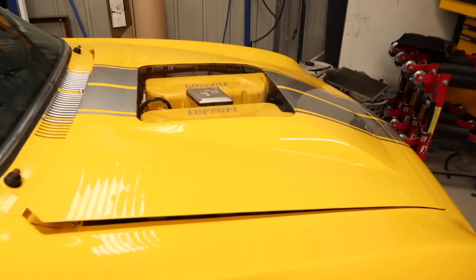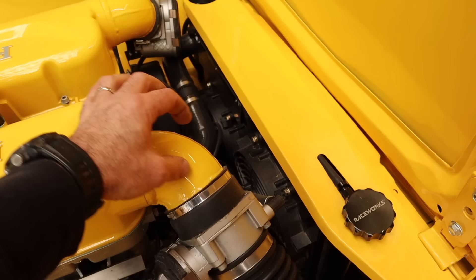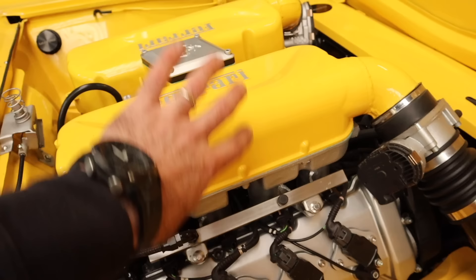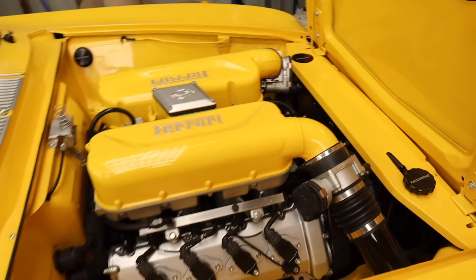What I think I'm going to do is come in and cut a panel off of this and add a flat piece in there, which will slightly diminish the diameter of the inlet — but not a great deal. There's no other easy way to do this. Those following from the start will know I already cut this inlet down about 70mm — I cut 70mm out of those runners — so there's not a lot of other options. A couple of flat panels means I'm going to repaint the top of this, but that is going to be the easiest method. I definitely don't want to add any more to the bonnet bulge.